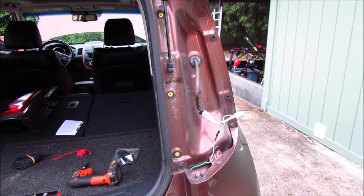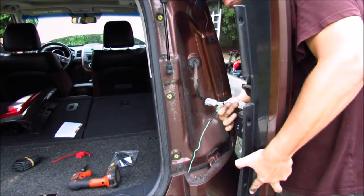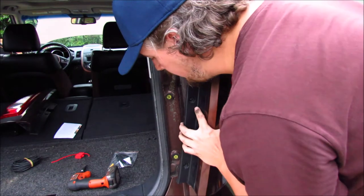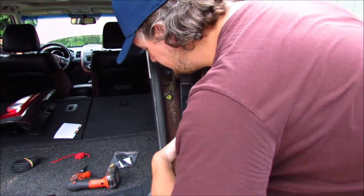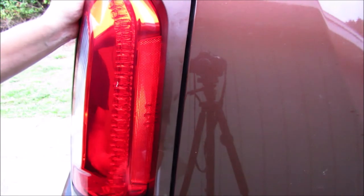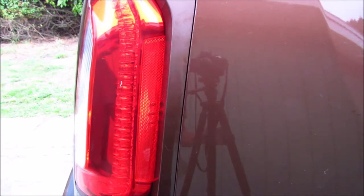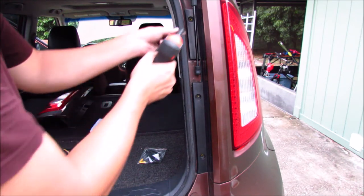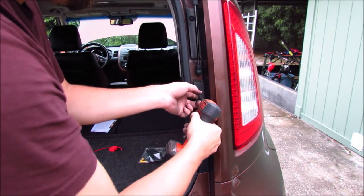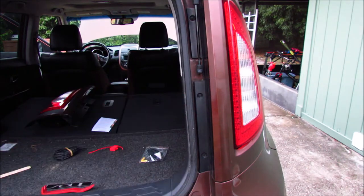The passenger side should be the simplest thing of this whole project. Support the weight of your tail light housing assembly, line up your clip making sure the male and female sides are engaging properly, and snap it in. Make sure no wires are going to get caught or bind on anything. You'll notice the receivers and pins, so line them up and just push it back in place. Then put the hardware back in — three screws in total, all the same size. Take your time, don't force anything, just go until things are a little bit snug. A little electric screwdriver really helps here.